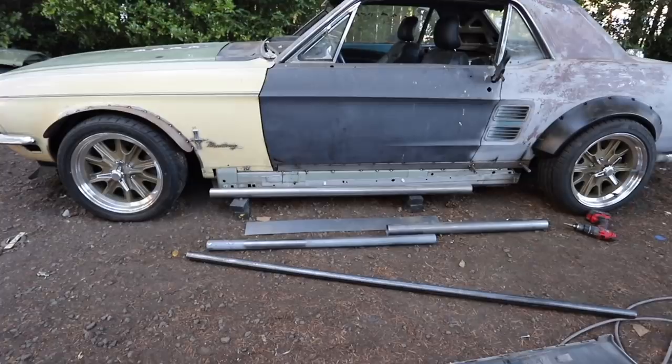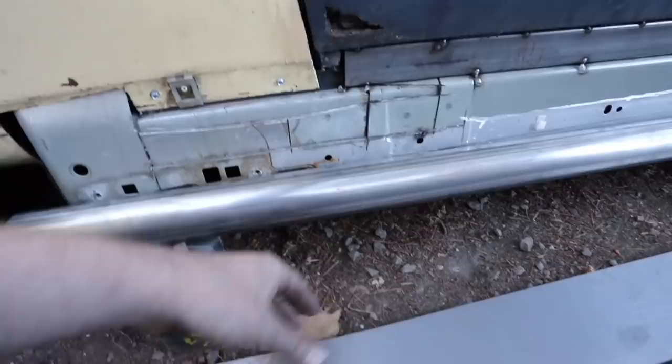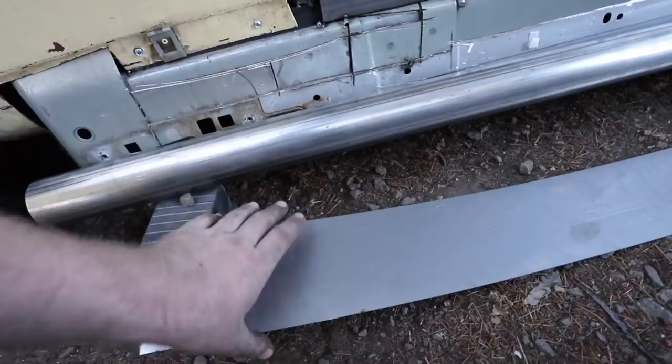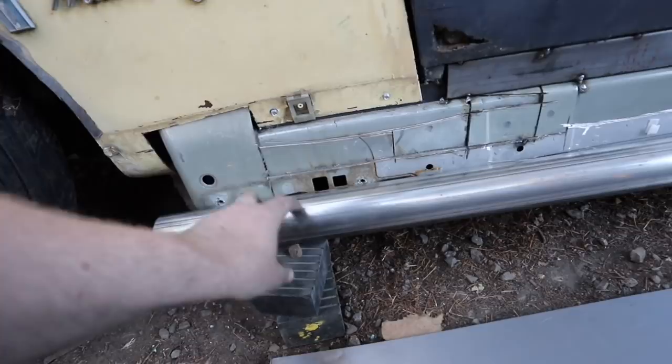So, for real though, getting into the technicals, this is going to get mounted into here. Then we need to take this sheet metal, trim it so it hits about here, and put a concave into it. The fun part is we're going to tack this to this tube right here, and then use our hands to bend it over, and that'll put a radius in it, flip it inside out. That'll start here, radius out to here, catch right here where we'll tack weld it, and tie everything in together. We'll bust one of these out, and I think it's going to look really good.